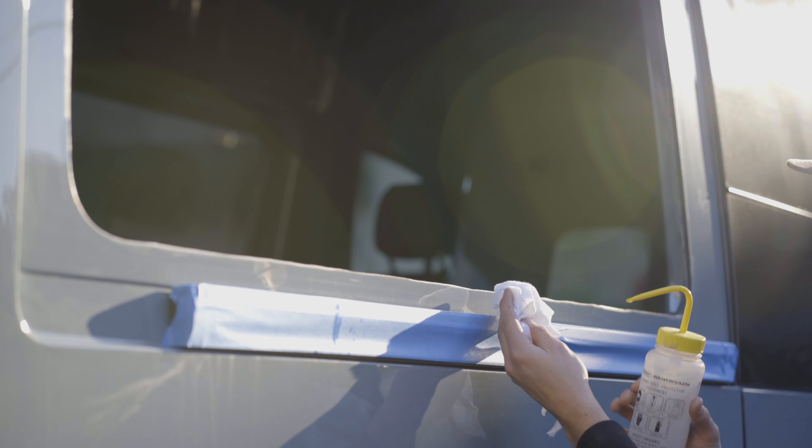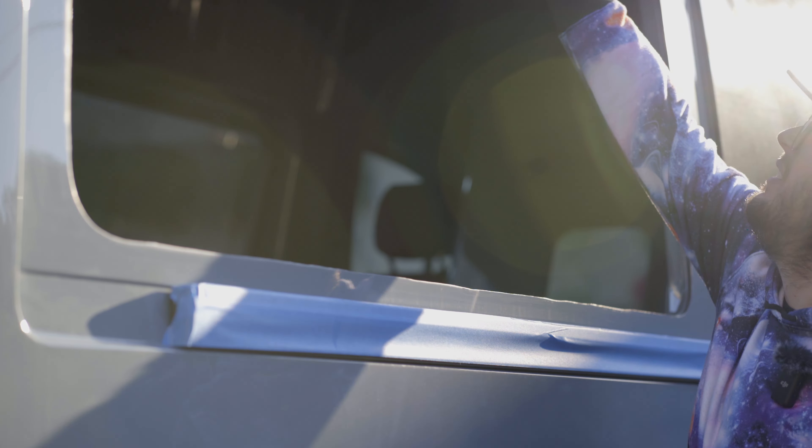With all the edges cleaned up, it was time to prep everything for paint. I like to remove the metal chips from the seal with an air nozzle and a vacuum, fold up the drop cloth in on itself, and try to clean every crack and crevice with the same method. Once that's finished, the last step is a spit shine with isopropyl alcohol. Now that everything's clean, it is prime time.